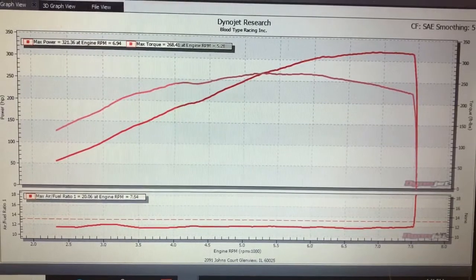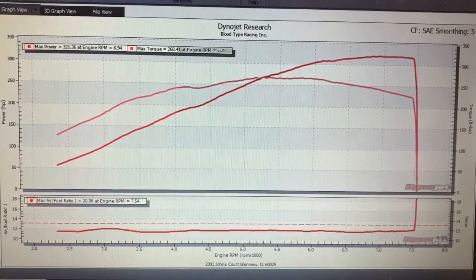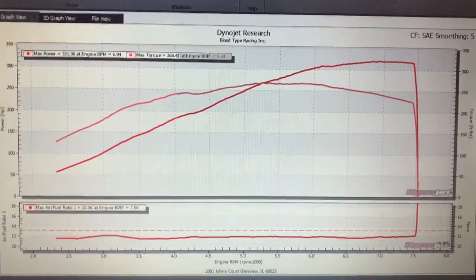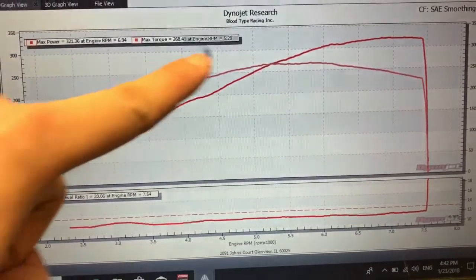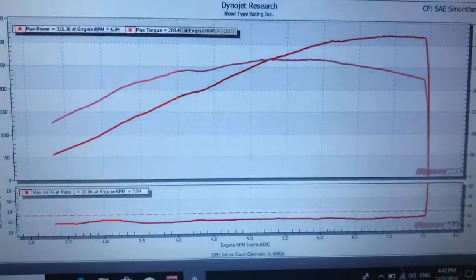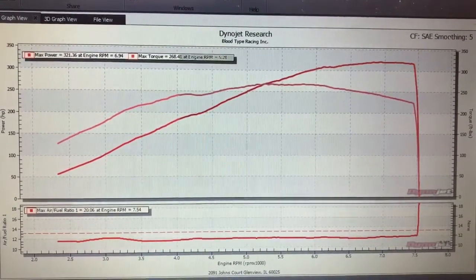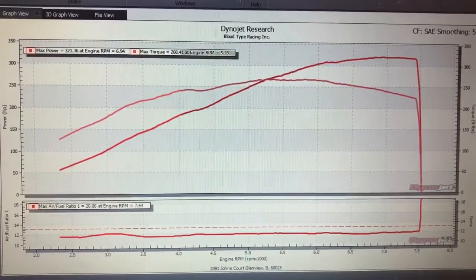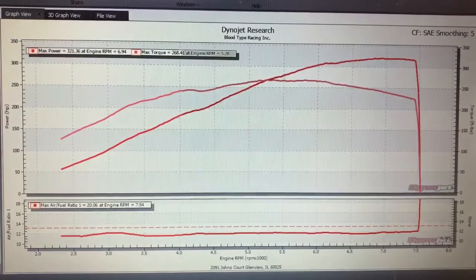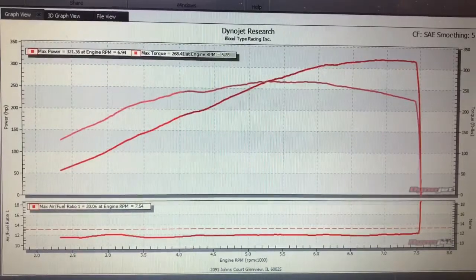The car is also running a GT28 turbo setup from ATP Turbo. It's a very small turbo that you can slap on and have fun with — almost no lag whatsoever. If you look at the graph right here, it's a consistent pull, so you feel almost no lag while driving and you have power all the way to the top. It's a great turbo especially for this customer because he does a lot of drifting and wants power anywhere under the curve. Not the right size turbo for people looking for high horsepower, but great for someone looking for more of that V6 power band out of a four-cylinder.